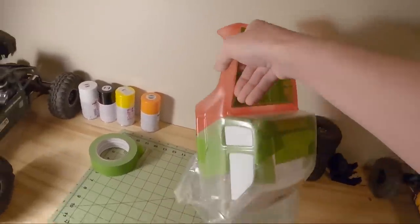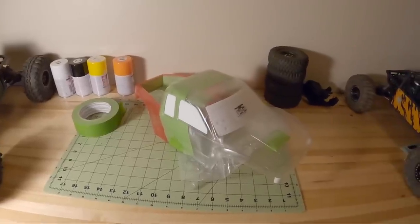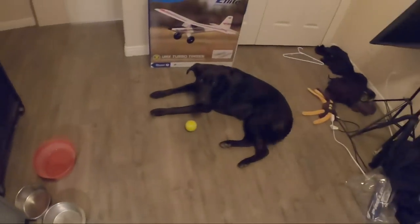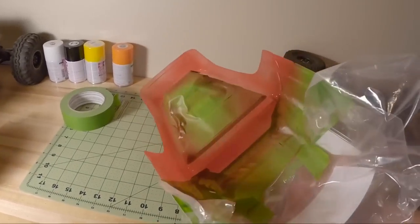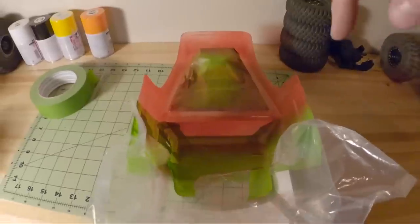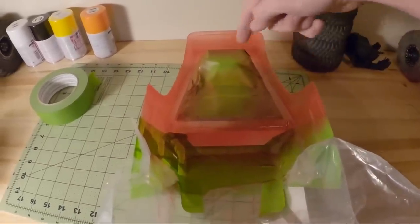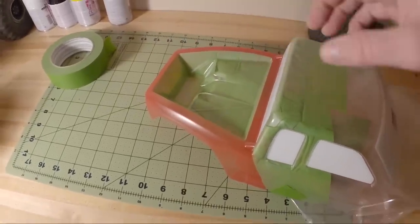This is going to take a long time and it's actually pretty late at night. I sprayed it in the garage and I'm going to hang out for five minutes, let it tack up a little bit, then hit it with more paint, continuing to do light coats — let it dry, light coat — until eventually it's red. At that point I'll leave the forward masking on and remove the masking from the drop bed, because I want that green area to end up black.